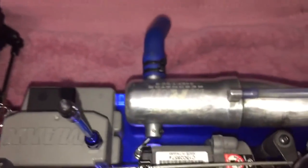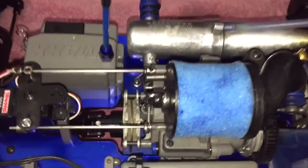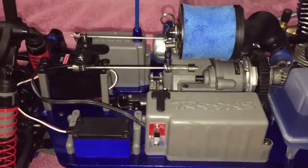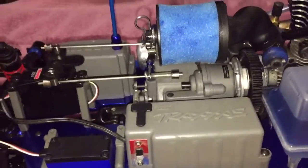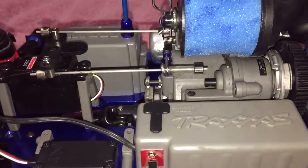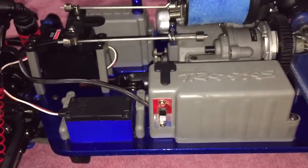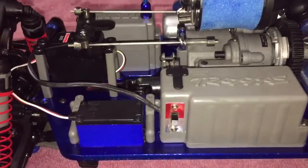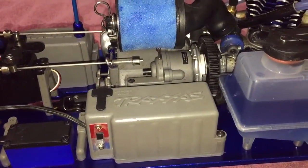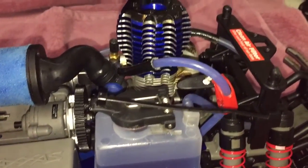And also, there was a mention about my transmission not shifting. Yes, it is not shifting. And I thought about it. The reason for that is when I did my video, this was a couple months back now, on the transmission fix, my primary gear in there, I recall that I screwed that grub screw all the way in, which obviously isn't going to allow it to shift. So I have got to get that fixed. So yep, I've got some tuning issues and some configurations here to take care of, which shouldn't be too difficult.